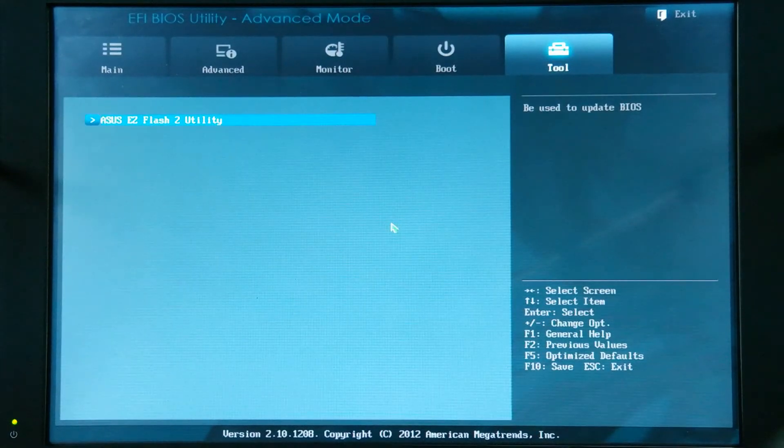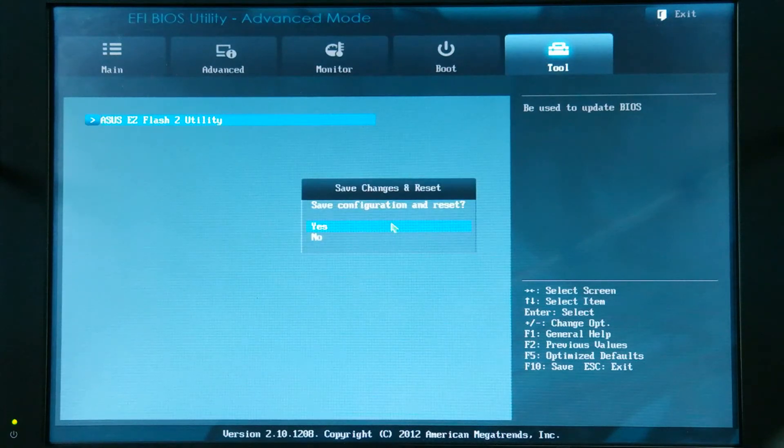Just for your information, it's very easy to make a BIOS update. For every resolution, for every panel, it's on BIOS. And this you can do directly in the BIOS without having to make any MS-DOS or Windows installations. Just go to the BIOS with a USB stick on which is the right BIOS and then you can go ahead. So that was the first step. We have a Windows 8 DVD in the DVD-ROM and so we go ahead installing Windows 8.